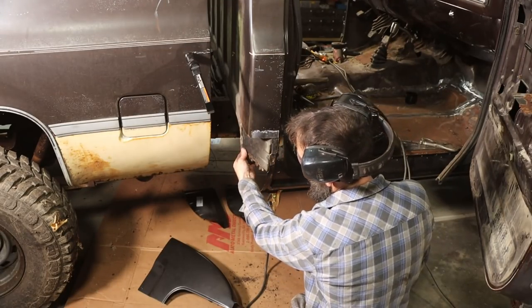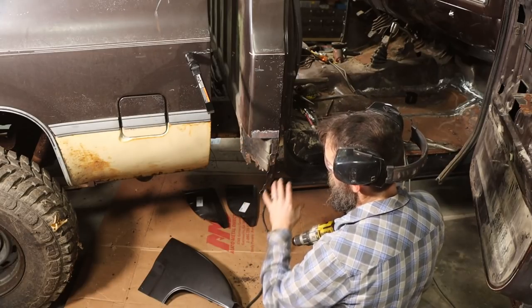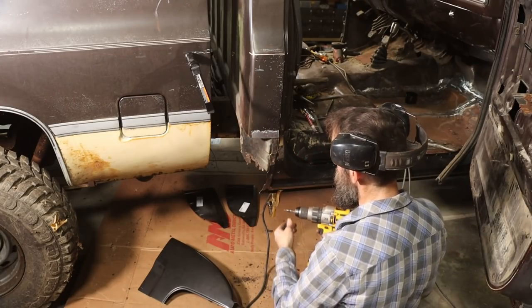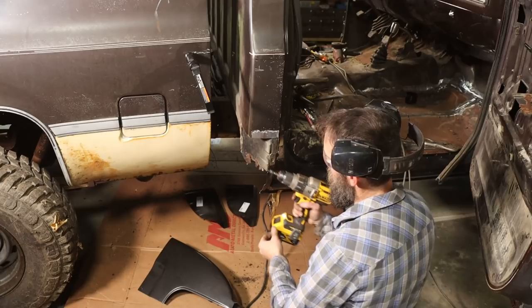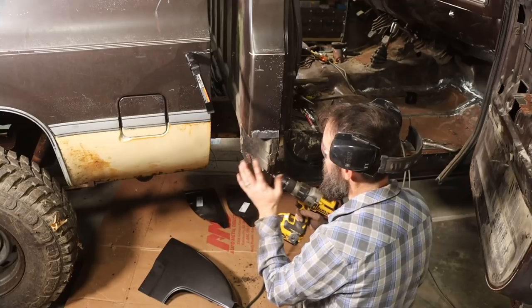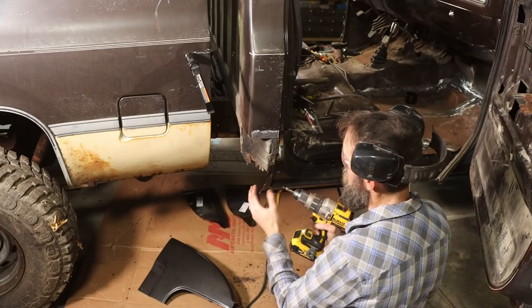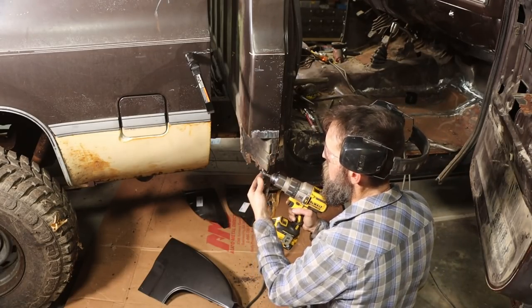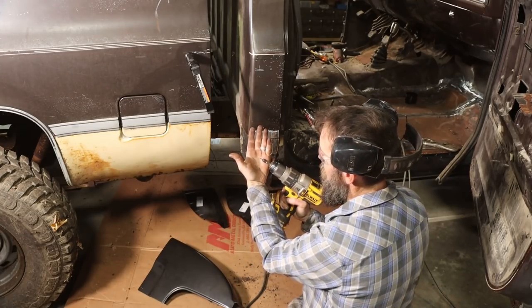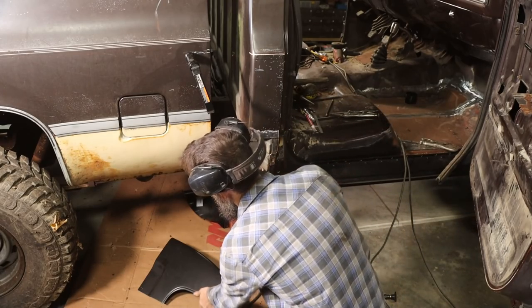We left the inner cab corner in there — what's left of it — just because I want to see where it's at exactly. You want to chop out everything at one time but we've got to slowly creep through this because it's been 20 years since I've done one of these. This is a spot weld drill bit — great for removing spot welds from material without damaging the piece of metal behind whatever you're trying to remove. A great little tool — you can get them cheap, I bought this off eBay, like maybe $10 for a big pack of them.